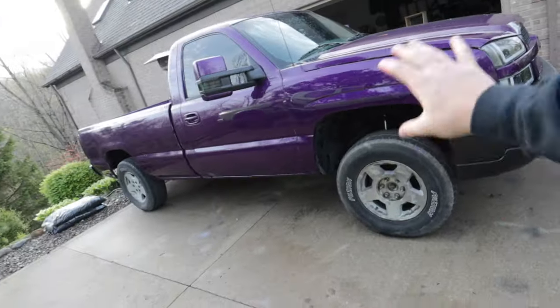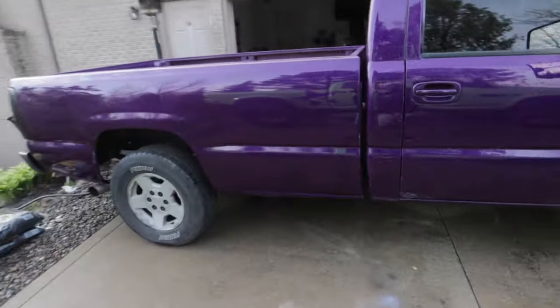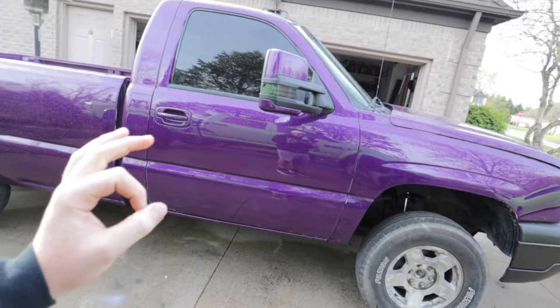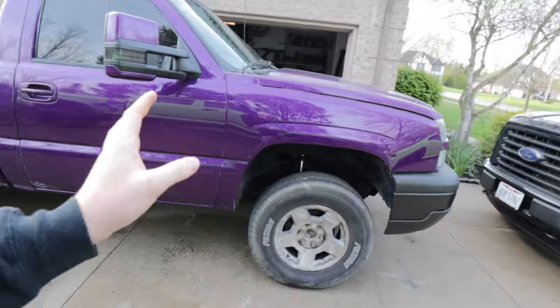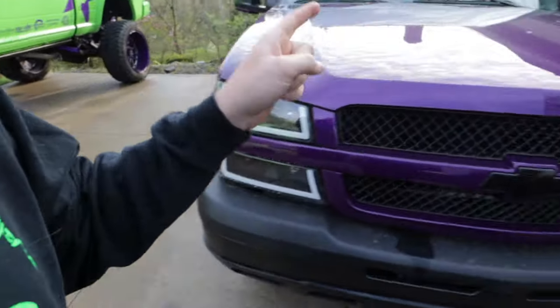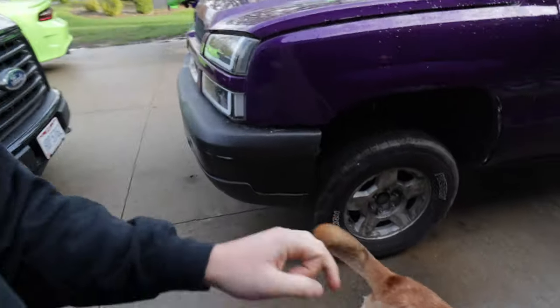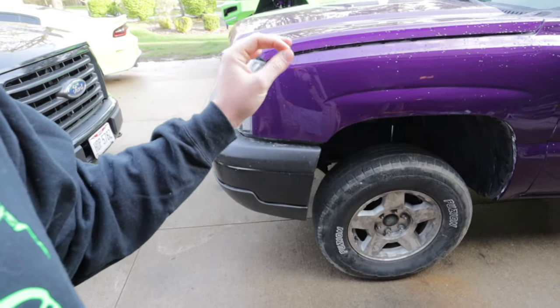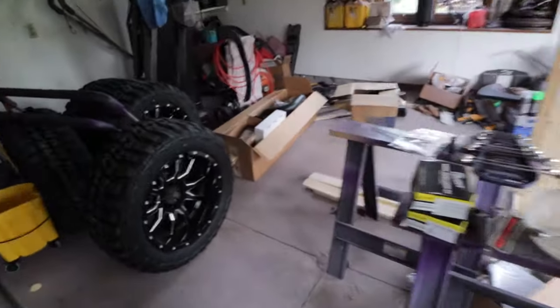Today is hopefully the last day we need to work on this truck and we can get everything all buttoned up on it. Right now it's about 7:17 in the morning and we are gonna head over and get this truck aligned. However, I kind of want to crank the keys down just a bit because this thing bounces all the way down the road and I do not want to continue riding like that. The Rough Country shocks in the last video really helped us out, really softens that bounce, but it's still quite bouncy. So I do want to see if I could crank them down just a few notches, and then the offset on our wheels over here, we will have to do some trimming a little bit later.